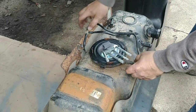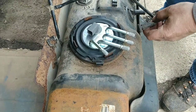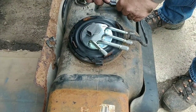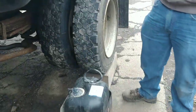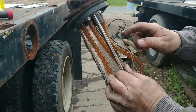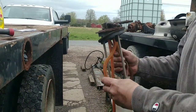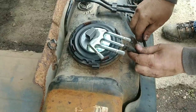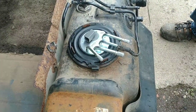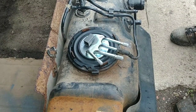We're going to put one line on here which is a vent — it goes down along the side. I've got to remember which one that was. This is the pressure line because you can see it comes from the pump. This is a vent. And this is a return line. So it is the middle one like it looks. We're not going to be using this one. This will be our pressure, this will be our return. So we're going to go ahead and set this tank up in there and then start making our lines for it.